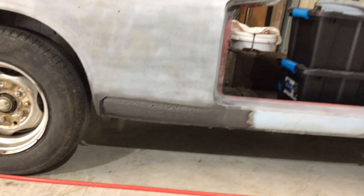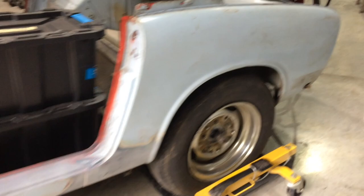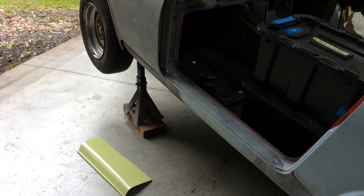I'm back on the Honda now — takes a little bit to get back going. I've got to set everything back up. I want to put this patch in there. I'm going to have to do something with this stuff — cut that out and weld something in there. At the moment I'm wearing my Australian safety boots because I've got a busted toe — don't want to rip my toenail off, it's just about to come off. Anyway, get into it. It's a 5-2 mix — 93% argon, 5% CO2, and 2% O2.